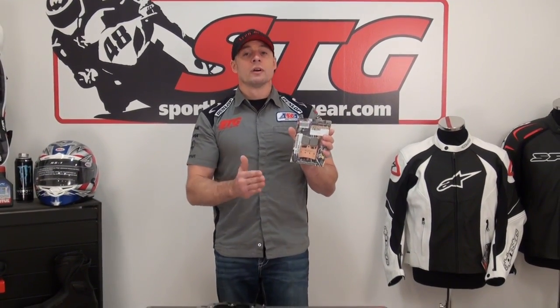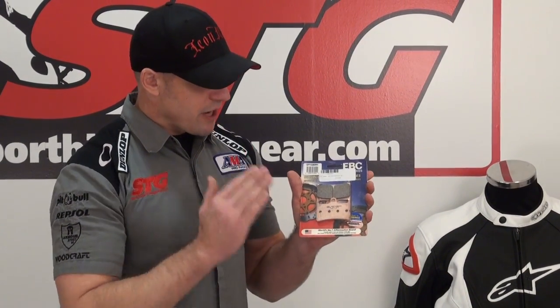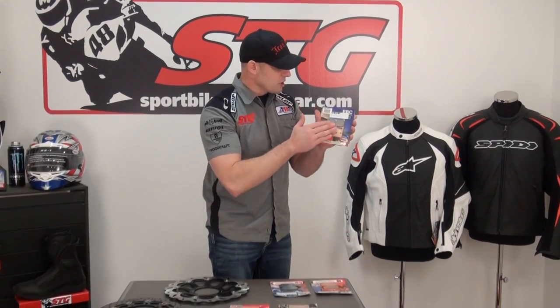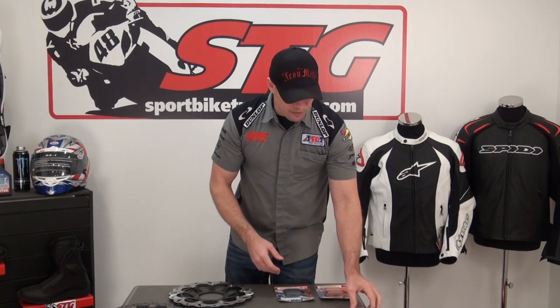The EPFA is great for the street and great on the racetrack as well. It's going to take you through novice, through intermediate, and probably even into your advanced group until you really start to push the brakes hard. And that's when you would think about trying the next step — the GPFA, which is their track-only pad. They've had great results with this in racing; it performs at a higher level than the EPFA pad. So each step from HH to EPFA to GPFA, you're stepping up in performance. What you do lose is that with the GPFA, they recommend you don't ride on the street. If you want aggressive street riding, they'd really like to see you use the EPFA instead. All three of those, like I said, are made in the US.